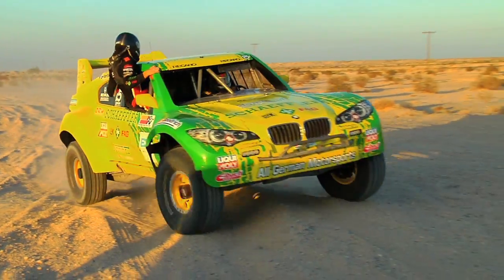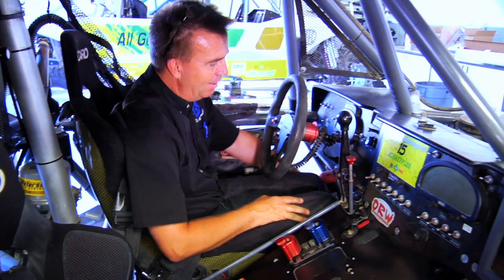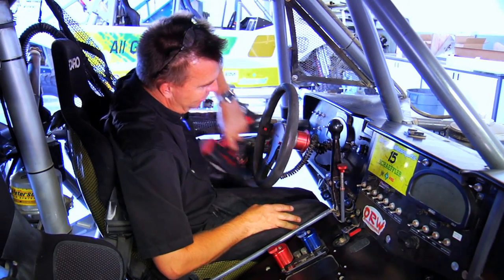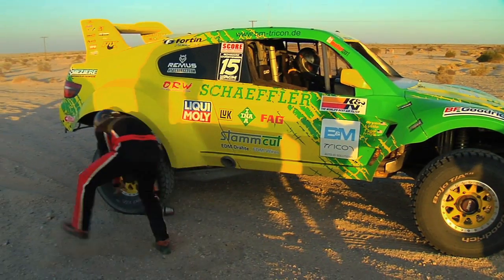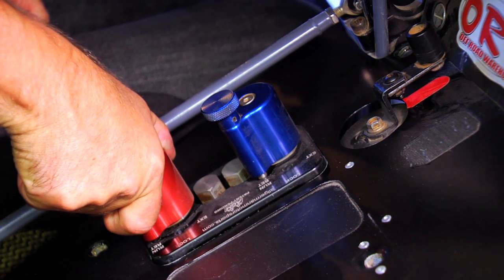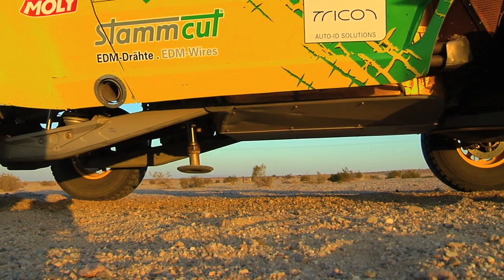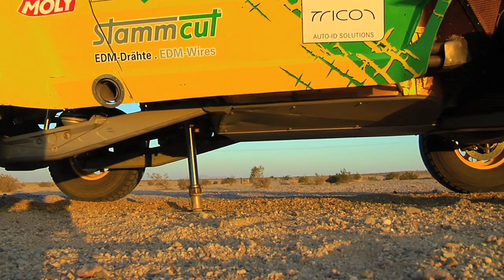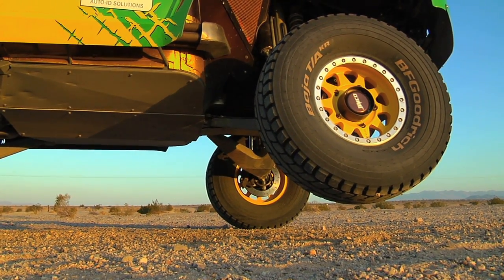The driver applies the brake. In our case, we have the impact gun mounted over here and we hand it to the co-driver as he exits the vehicle. Let's say we have a right flat — we turn on the right side valve to the extension and then turn the power on. Now the fluid from the power steering pump gets directed over to the right side jack.